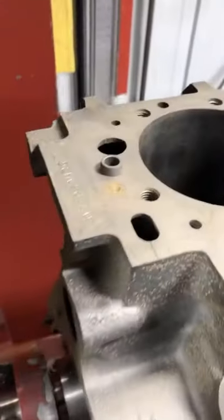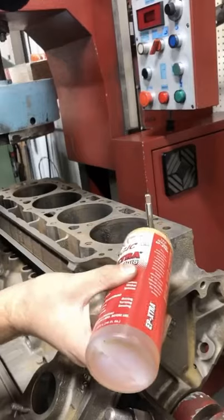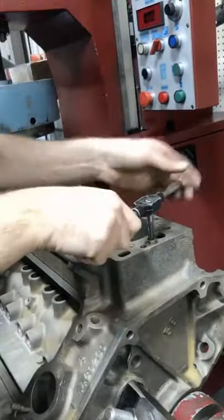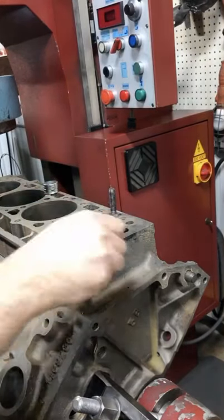Here I've got a 1958 365 Cadillac that I need to remove the head dowel rings in order to deck the block. I decided to finish tapping with some tap magic and the tap handle. The goal here is to remove the dowel rings without rendering them dysfunctional, as replacements can be difficult to find on an old and uncommon engine such as this.